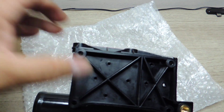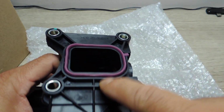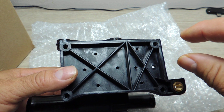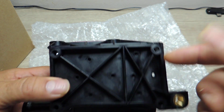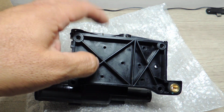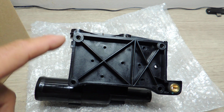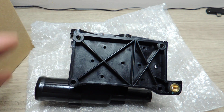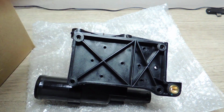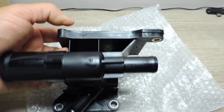So I got called to get it checked, and I found that the seal here on the top was leaking, and it was making a slight puddle, but there was still about that much coolant in the reservoir, so it's not like it completely emptied out or overheated or anything. It was just the coolant falling on the exhaust that made that smoke. So I went ahead and refilled the coolant and drove it back home. Not a problem, didn't even get any smoke, but as I got home I did check this side here, and there was a puddle there, and you could see the air coming out of it. And that's the reason for this new part.